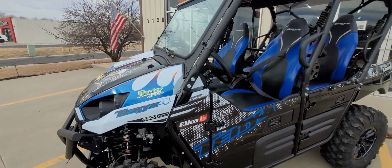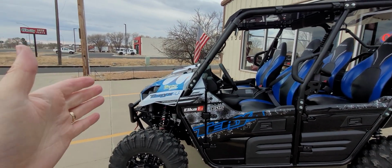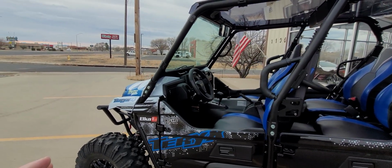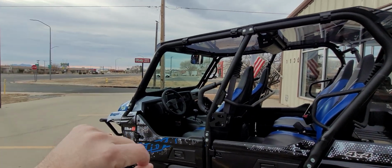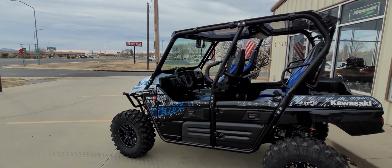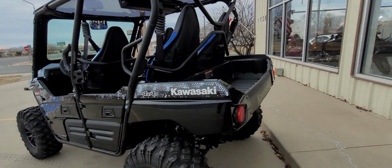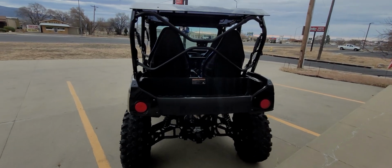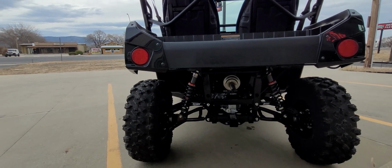You can get that from us. Very well built. It's a 9-port block, 6 key activated outlets with 3 full hot outlets. So you do have key on and key off power, and you can transform that very easy with the switch of 1 wire. You can make the other 3 ports over to a key activation as well, so you could have a full 9 key activation fuse block on that, waterproof and everything. Yeah, we do it badass. So what can I say? You get that from us, you give us a call, just ask for the mule fuse block, and like I say, like Frank's Red Hot, we put that stuff on everything.